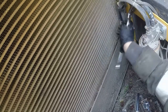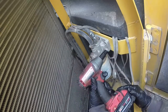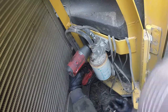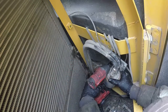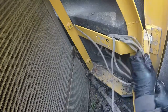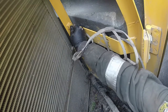Now we need to disconnect the bracket for the engine coolant filter and move it aside as it'll be in our way. The next thing to remove is the AC condenser — but do not disconnect the AC lines, because they are on high pressure with AC gas inside. We just need to undo the bolts holding the AC condenser to the mount, that's it. Remember to put those bolts back and don't lose them because they're all different.